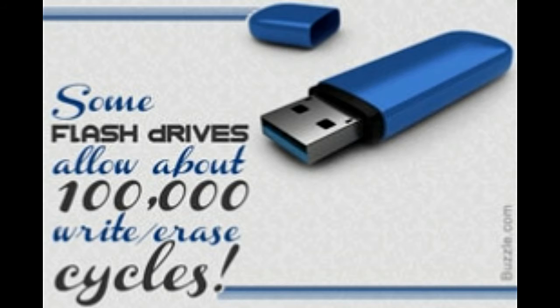During the early years of their evolution, flash drives could not survive too many erase cycles, making earlier flash drives unsuitable for data needing frequent updates. To fill this gap, vendors devised wear leveling techniques that relocate writes to physical memory locations. Today's devices are made to survive a larger number of erases.